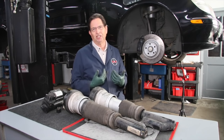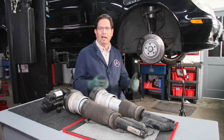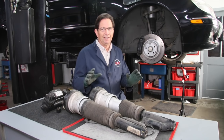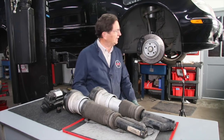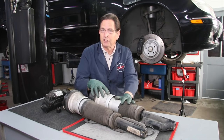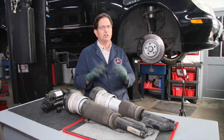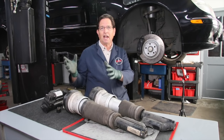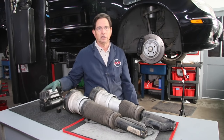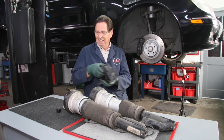I only drive locally — at most 200 miles — so this isn't a big concern. But if you're going cross-country and want the car to be reliable, if there's any question at all, just replace the rear air springs when you redo the fronts. In my case with the driving I do, I'm going to leave those on for a while and see how they behave, since there are no visual outside signs they're about to fail. This strut is a beautiful piece of art — you can buy new OE ones, rebuilt OE ones, or ones from other manufacturers with claimed improvements.